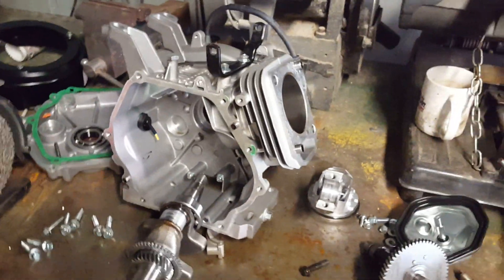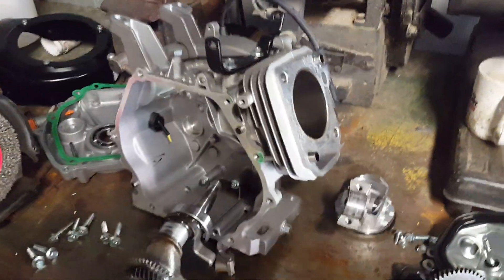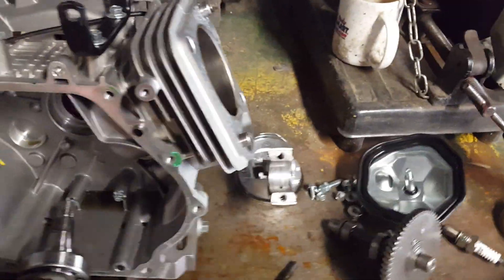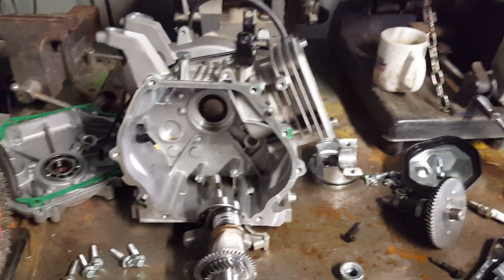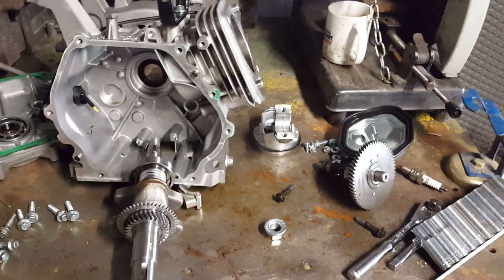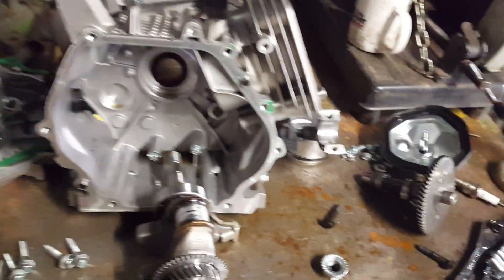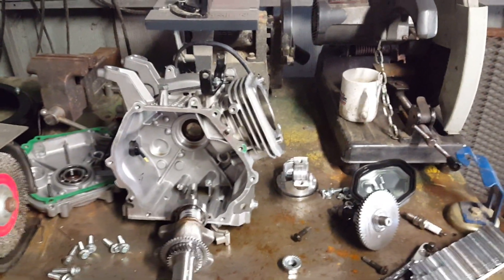For 2016 they're a Hemi head design, so I had to redo all of the throttle arrangement and make some modifications, cutting and adapting bits from the old one onto the new one. In the next video I'll outline the changes between last year's model and the current model. To summarize: don't run too much timing in a Predator 301 — nothing more than a 4-degree advance key — especially in a mud boat motor where you won't have as much airflow as in a go-kart application. And don't run too much oil in any small engine, or this bearing failure is going to be the result.